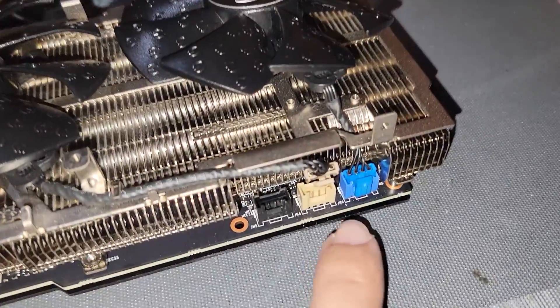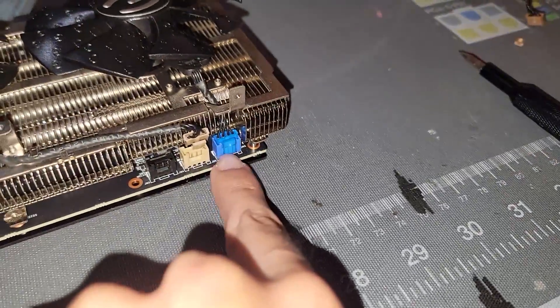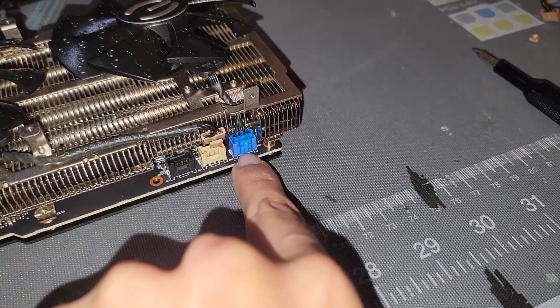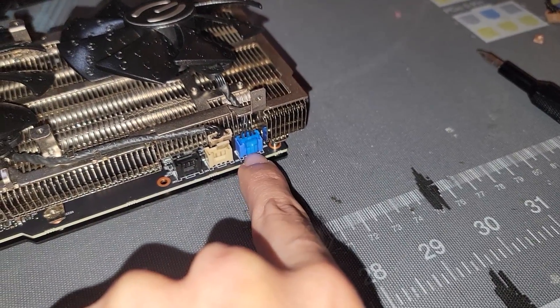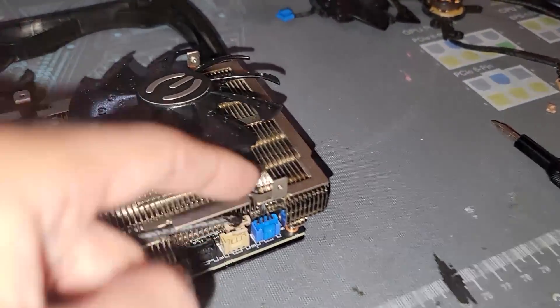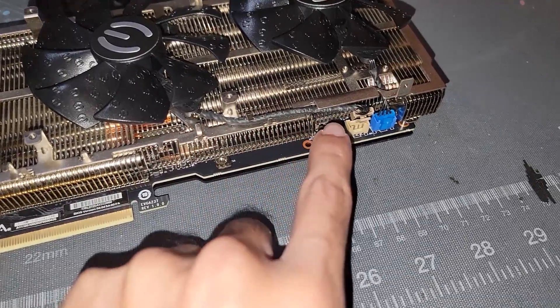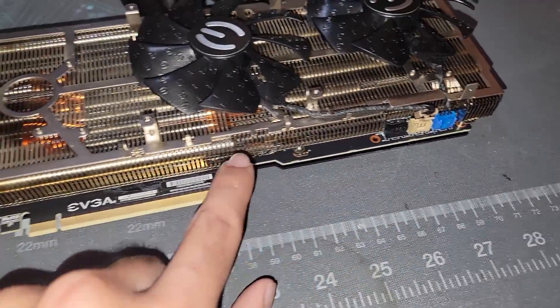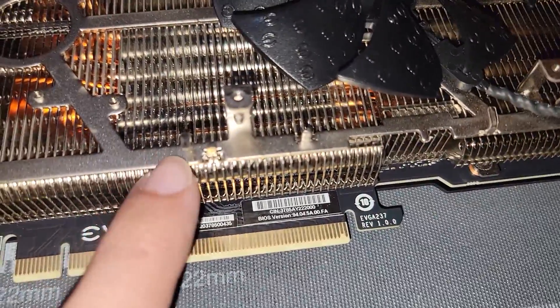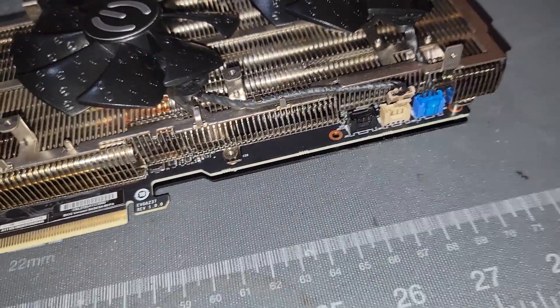Quick update: I did attack this from the front and broke the clip on the middle fan that was already broken. I used a flathead and pried up carefully to lift it over the locking pin, then pushed up — but I bent it a little too far. That's okay though, it's the old one. For the new fans: the blue one slips right into this channel here, push it in. The brown one follows the original channel that EVGA designed — pin it in and plug it in. Then the black one does the same thing. You can see these very tiny grooves where the wire tucks in — follow that channel all the way along and plug it into that connector.